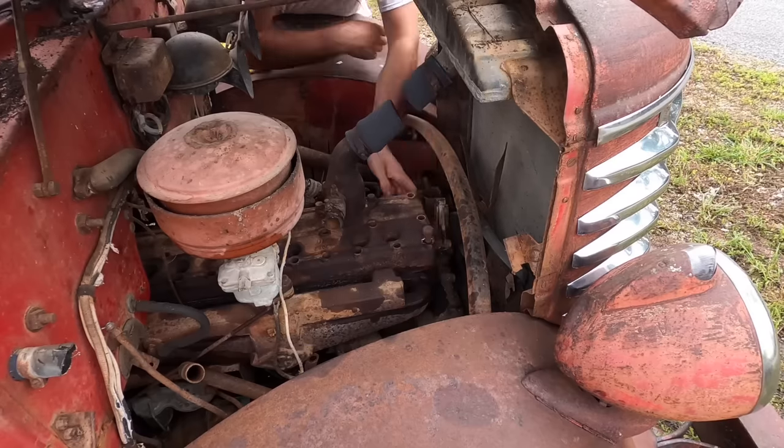The cap's a little corroded underneath there — there's no shiny spots on it like there's supposed to be. Let's take the rotor off of it — it's not too bad, looks pretty clean. Going to O'Reilly's to get a new coil because I think the reason it would kind of hit and wouldn't run is this coil. It came off that Datsun over there that we were working on and got running. So I got this new one — it's 45,000 volts, so hopefully you can taste this one when it shocks you.